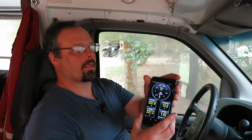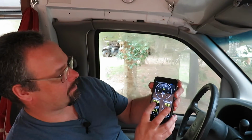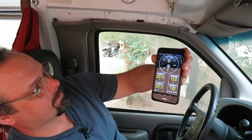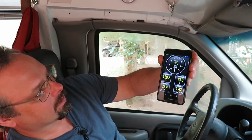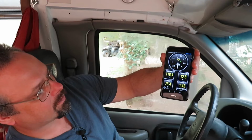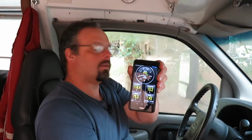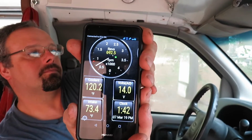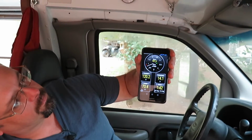Also you have, here's my real-time information. There's my tachometer. I have coolant temperature, which that stuff is wrong because it's not hooked up. Once it hooks, you'll see. Okay, 120 is the coolant temperature. Let me start it up. It might be a little loud for a second. Okay, now you can see the RPMs are going up. They will go up and down with the engine.